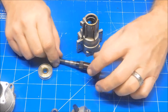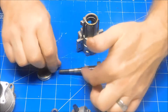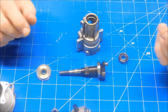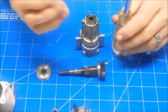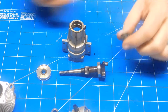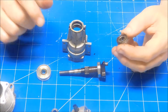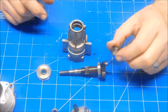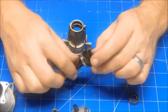The rear bearing came out with this, and this pinion isn't willing to come off right now either. There's a little collar that acts as a spacer between the front of the housing and the bearing — all of that has to come off too. Since I'm changing the bearings anyway, I used my nut driver and that thing popped right out. One thing that's unfortunate: whoever put these bearings in left shields on both sides. Typically you don't do that — you want to remove one side of the shields so the race and balls get lubricated. This is a recipe for premature wear and destruction of a bearing.